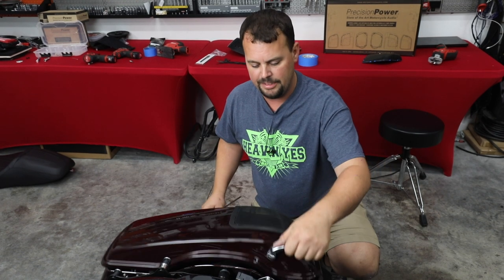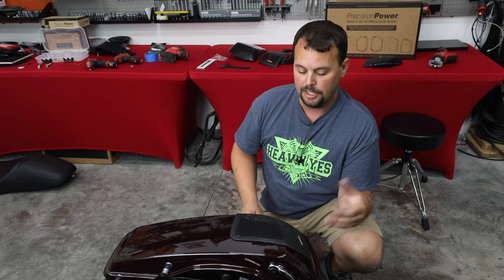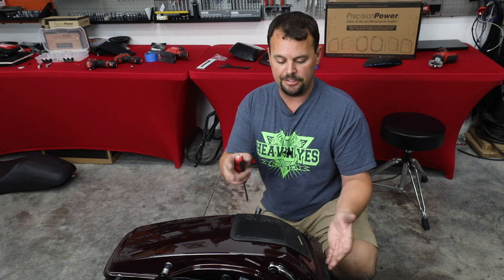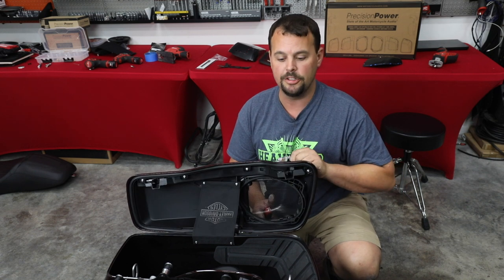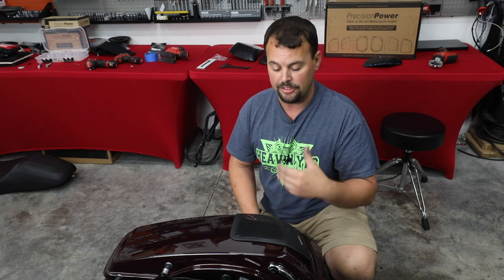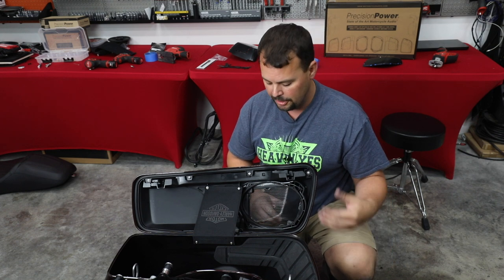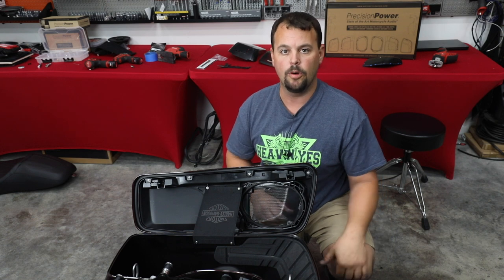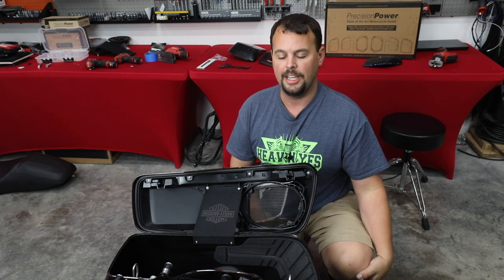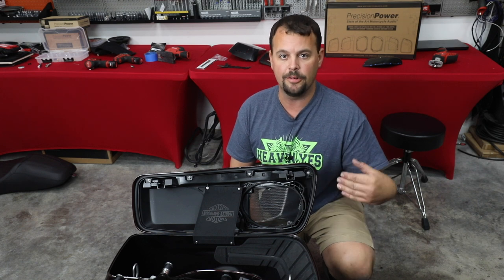We've got our four screws tight and a really good look. It looks like a CVO-style lid — it wraps along the front just like the CVO does. There are a lot of advantages to this versus buying a boom-style lid: first, it's going to hold a six-by-nine, not a five-by-seven, and it also angles that speaker at about 15 to 20 degrees toward you for better sound. I think Precision Power has done an excellent job on this grill cut kit setup. If you use the Precision Power MAS 694 or 692 six-by-nine, it's going to mount to this perfectly with a great watertight seal. They are sold by themselves, so you could use other six-by-nines — but keep in mind, not all have the same flange style. At volunteeraudio.com we also keep spacers made by American Hardbags to adapt to ones that don't have a flat top.